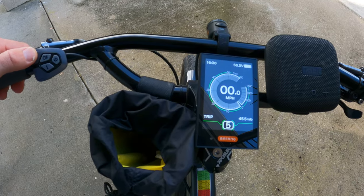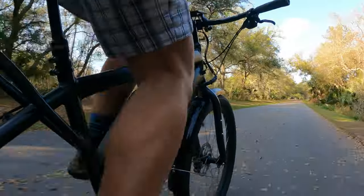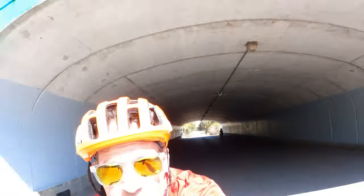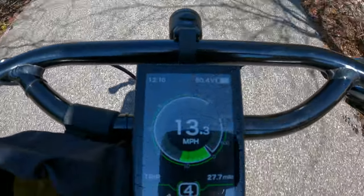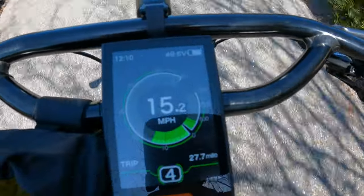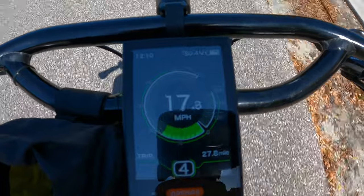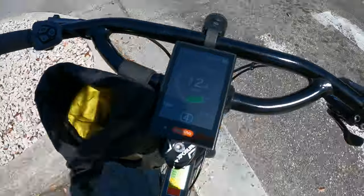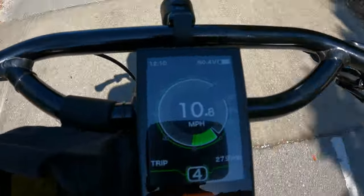There are nine pedal assist levels. A basic understanding of how it works is: the higher the pedal assist level, the more power to the motor and less pedal cadence comes into play. Pedal assist one through five, you can basically control your speed by how fast you pedal — higher pedal cadence will cut power to the motor. Anything above pedal assist five, the motor will not cut power no matter how fast you pedal. Here's an example: I'm in pedal assist four right now, and you can see it's maxing out at around 13 mph. So I start upshifting, and you can see how it speeds up — it's all based on cadence at this point. I'm slowing back down again, so I'll shift to an easier gear. You can see how it goes slow again as soon as you upshift, and it speeds right back up again.